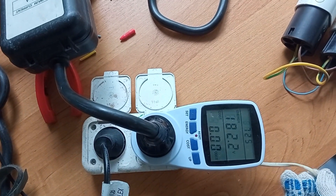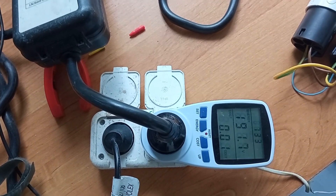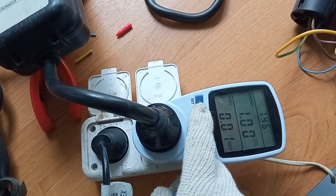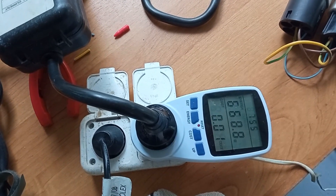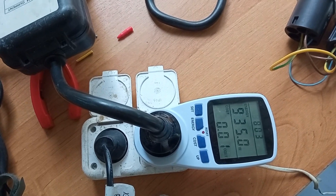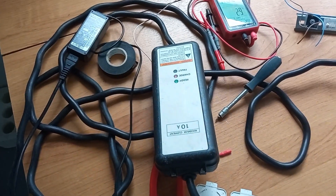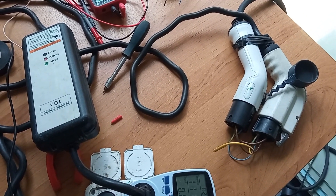The cable is very thin here so the voltage is dropping down. The consumption is only about a kilowatt and jumping around. I believe the power is not enough here, but the vehicle is charging — you can hear the pump. It is charging, cool cool cool. So at least we can say that proximity pilot is optional and this EV does not need that, only the control pilot.